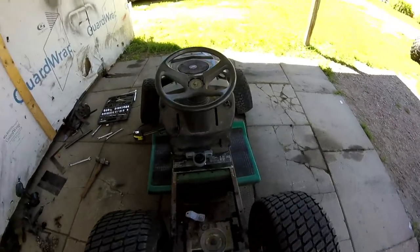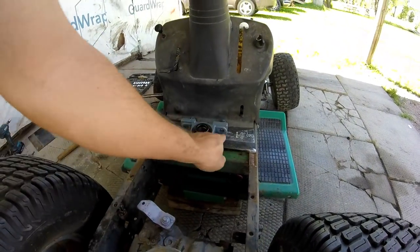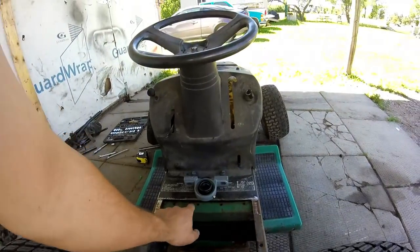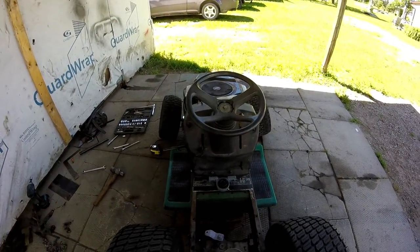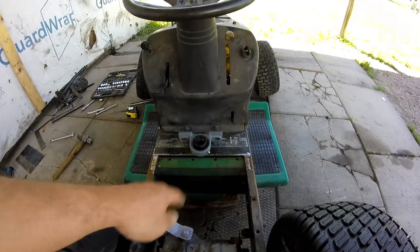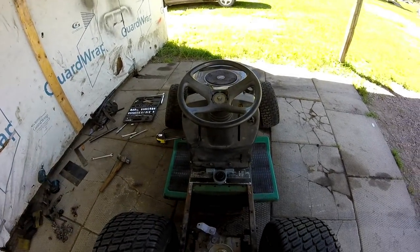So I'm gonna take this out, drill two holes so I can bolt that in. Half inch holes, and weld this solid in, and then do the bottom the same. I'm gonna drill both of them the same, drill this one and that one at the same time, so we get the perfect alignment. So I'll catch you when I get that done.